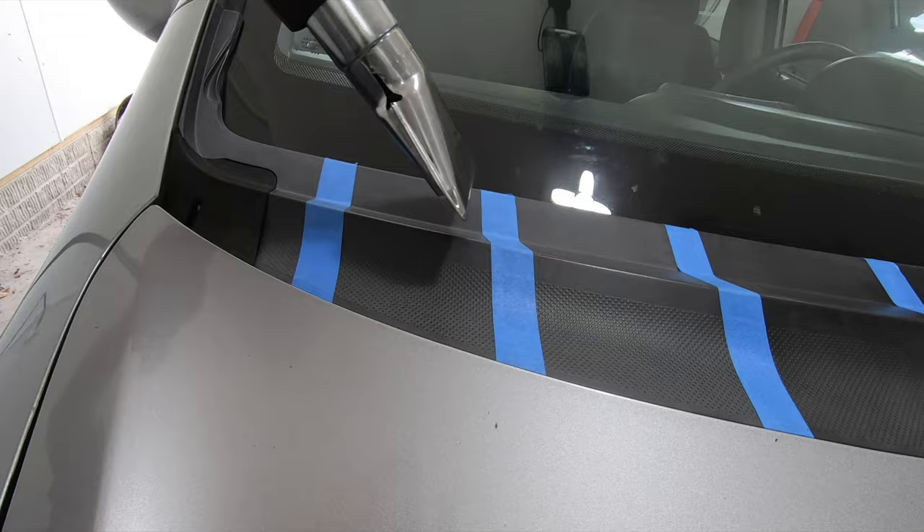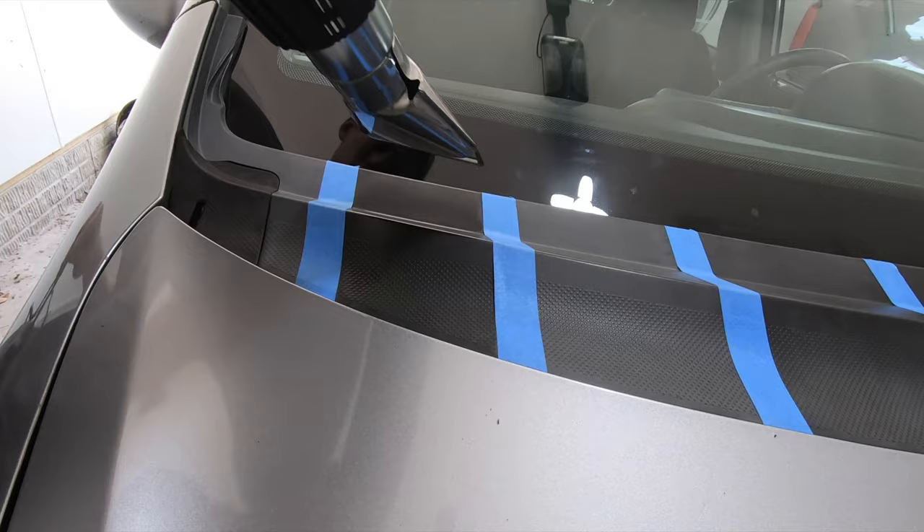The first thing we're going to talk about is the heat gun. There are a ton of videos online showing you how to use a heat gun to restore plastic trim, and yes you can. The main issue is it'll look good for about three to four months and then it's going to fade even worse than when you started. What it does is pull the oils inside the plastic back to the surface. Once those oils get degraded by UV light it fades again — and when it fades again it fades even worse. There's only a limited amount of oil and dye inside that plastic trim, and each time you bring it to the surface there's less and less as it gets broken down.